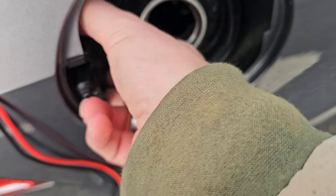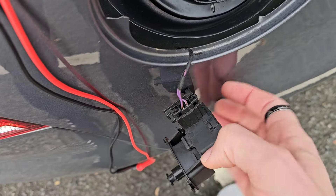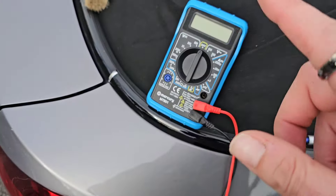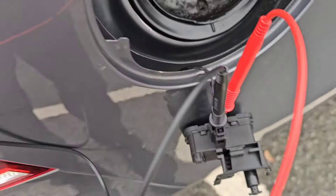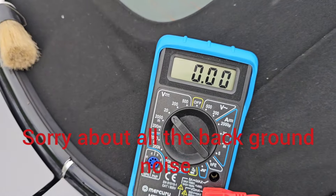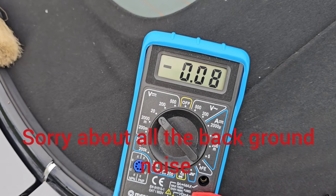This just slides out. What I'm going to do is put the multimeter here and here, lock and unlock, and see if the multimeter fires up with a voltage. Just get these pins plugged in. Multimeter's plugged in — one there, one there — just keep an eye on this. Just lock the car, unlock the car.